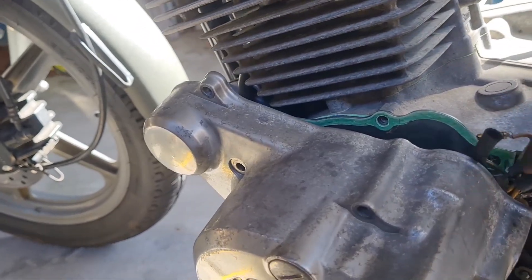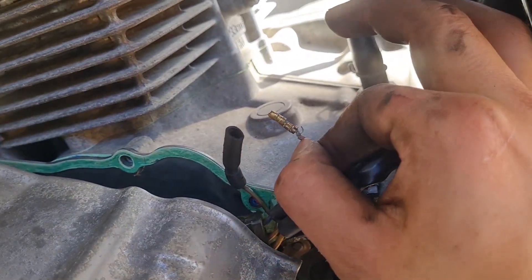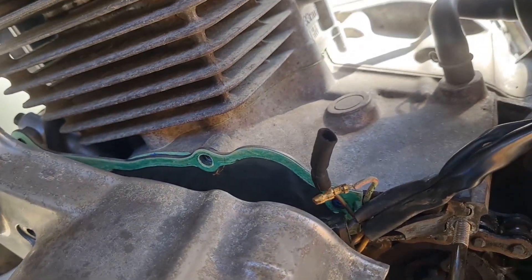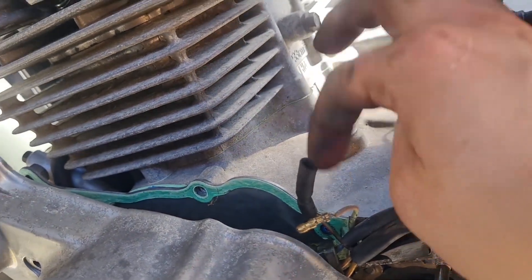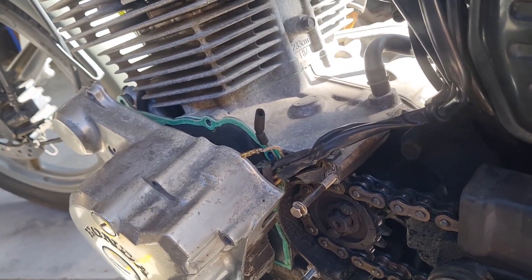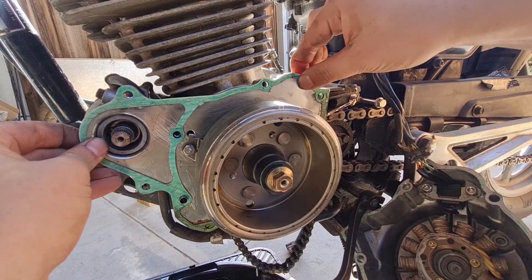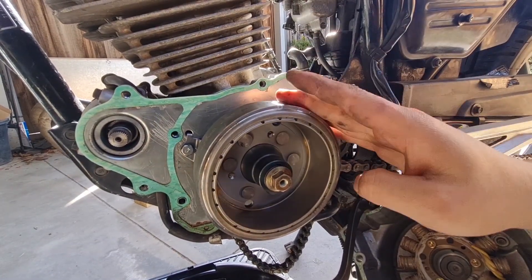Actually, bad news. I just noticed that this female terminal is connected to the wiring harness, and the part I need to replace is actually connected to the switch which I think is behind this cover. So there's every chance that even if I do fix this terminal it still won't work, because there's every chance that the switch behind here is dirty or broken. We're going to have to somehow take that switch out and test it. The sensor is behind this plate and I don't know if I can take it off without taking this whole thing off, and I really don't want to do that.